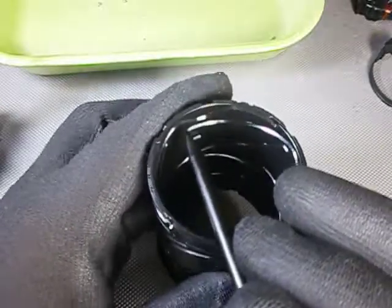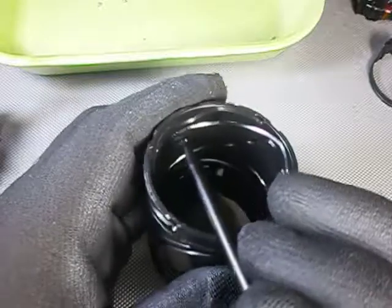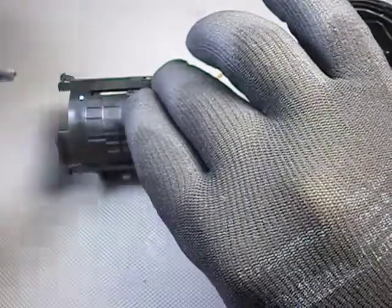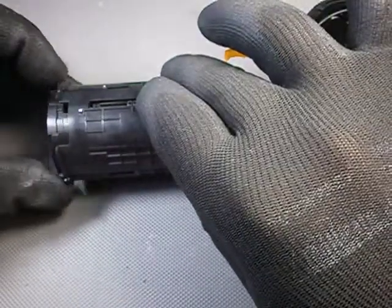the second lens element has to get in first. The thing is that the second lens element also uses the inner cylinder slots as a guide for its followers. So it is necessary to slide it first into the inner cylinder like that, with the widest leg aligned with the flat cable.